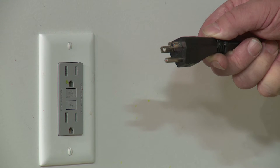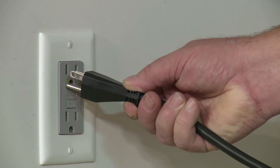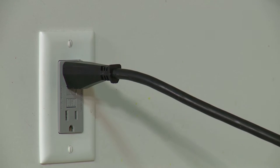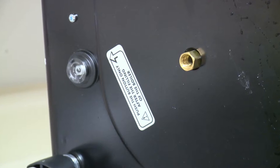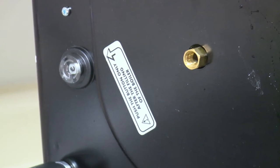Your VaporBlast will run on a standard 120-volt grounded outlet. However, it is ideal to plug into outlets on a dedicated circuit, preferably 20 amp if possible. Make sure to check circuits and breakers before use. There is a circuit breaker reset button located on the bottom of the unit for load protection.